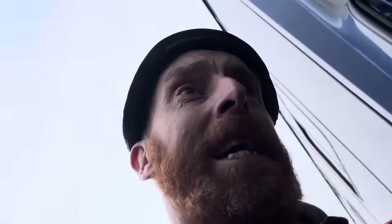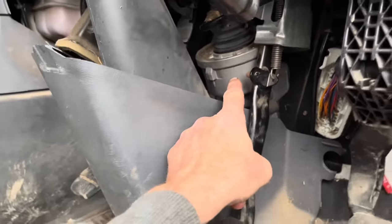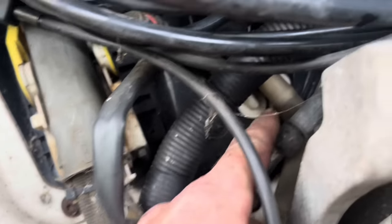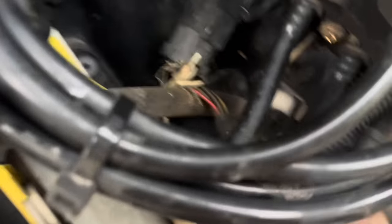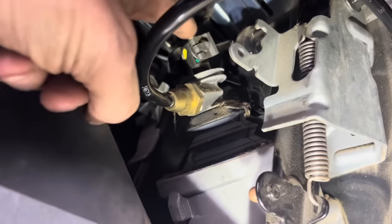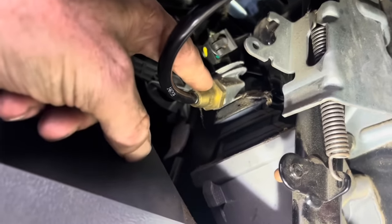Back to the video — so basically I've got that master cylinder to change because it's leaking out air at the front of the grill. There's three bolts fixing it in — one, two, three — and there's a pipe down there to remove, that's the clutch fluid pipe. There's a clip on top of the pedal, and there's the pipe for your air-assisted clutch. Without air assist, pushing the clutch down is really hard work.